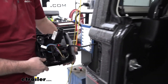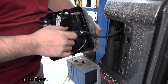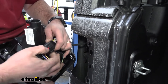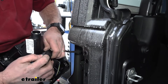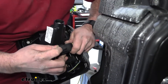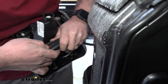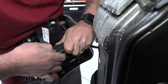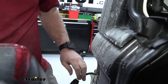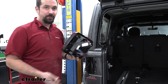We're going to be tying into the wiring on the bulb itself, so we'll go ahead and get this unplugged and separated from the vehicle — that makes it easier to work on. To do that, simply pull the red tab back to unlock it, then push in and pull on the plug here — these two should separate. We can also unclip from there if you need a little more room. Now that we have this separated, we'll put our taillight in a safe location, and then do the same thing on the other side to get that taillight out as well.